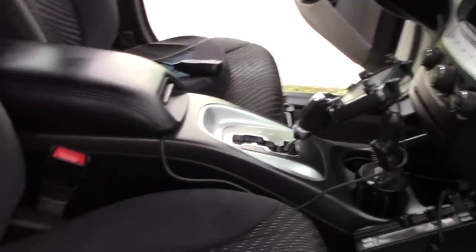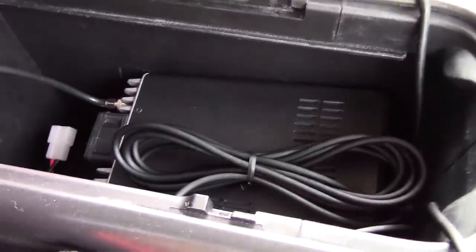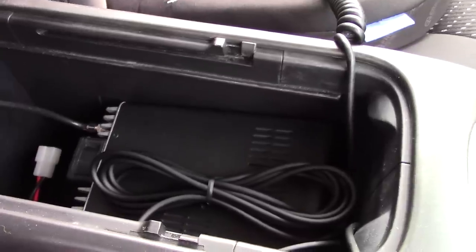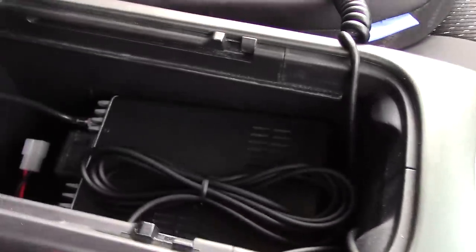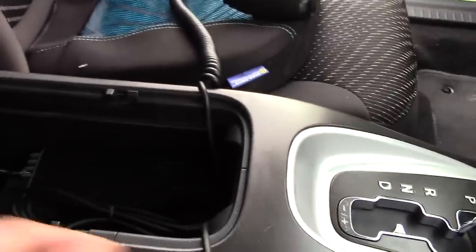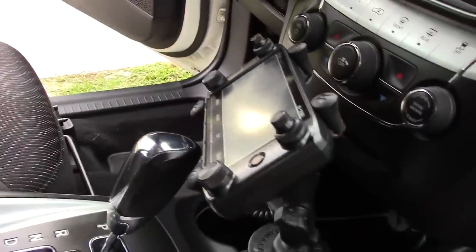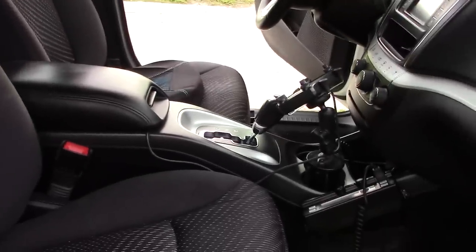Until I figure out how to strap that wire, my little center console — there is the base of the radio, the actual 5100. You may not have that option either and may mount it under the seat, on the side, or under your dashboard — however you do it. But this fits just in here — pretty cool. I ran the antenna wire out the top for now; this closes without pinching at all. I've got to figure out a way to get these wires out of here, but it'll keep it discreet. I could take the microphone when I'm done and put it inside there — you won't even see the microphone. I could pull the head out and you won't see the head. It makes it really kind of anti-theft and non-permanent.